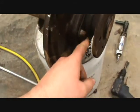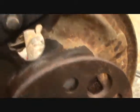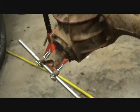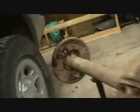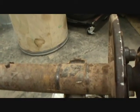I was trying to pull off the nuts that go on here. In order to do that you have to put a three-quarter inch socket through here, and it was stuck — not seized, just kind of stuck. So I went and put a long rod through here and twisted. When I twisted, everything moved. That side doesn't make any sounds, but this side right about there makes all kinds of really nice rusty crunching sounds.